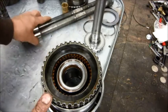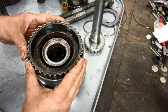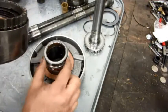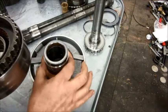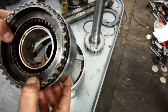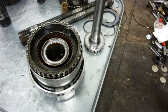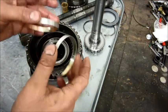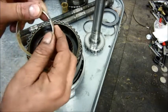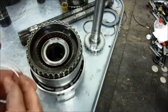Some of these modifications — you'll say that's not a performance mod, and you're right. This part, those bushings are worn. This bushing is worn where it rides on here, and when it moves around you're not going to get a good seal, which allows hydraulic pressure to leak out. It's supposed to be gripping this clutch, and then you have a clutch failure. For a stock rebuild, maybe it's okay, but because I know this is going to get pushed to its limit, I've got a set of new bushings to go in there. They're so thin they'll just come apart — it's really tricky, but I'm going to have to change them or else I won't have a good product in the end.